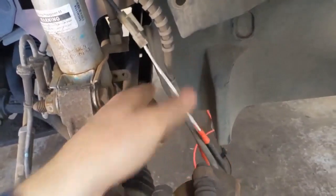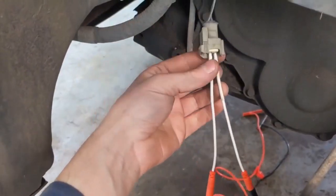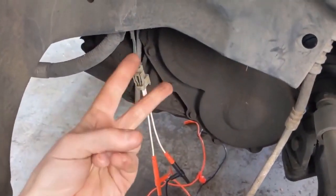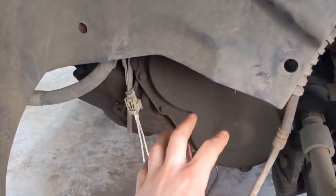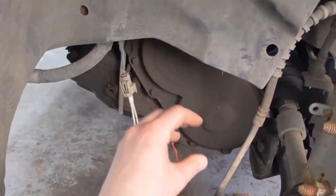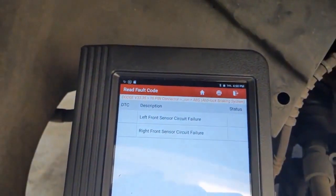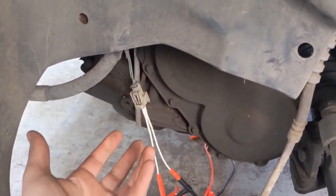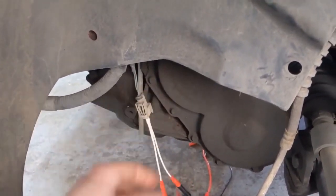Because this vehicle can't be swapped, another option is a jumper wire. You connect the sensor side, run under the vehicle to the other side, and plug into the harness side — in effect swapping the signal over to that harness. So I've got my leads in on one side and plugged into the harness side on the left front. If your code now changes to show both codes, that's expected since one side is unplugged. If the sensor is bad it will continue to throw a code. If it only remained one-sided, I'd be looking at bad wiring from the connector to the ABS module.